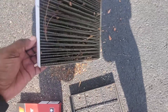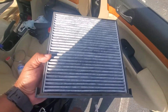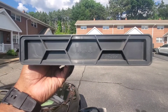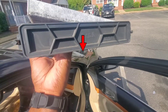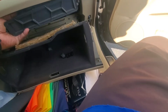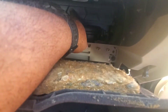That's atrocious. But then you take the new one and put it in there. Make sure your airflow arrow is pointing down — let me pull it out and show you. There it is: airflow arrow pointing down, just like this one. Push it back in and it should pop into place. Yep, that's popped in.